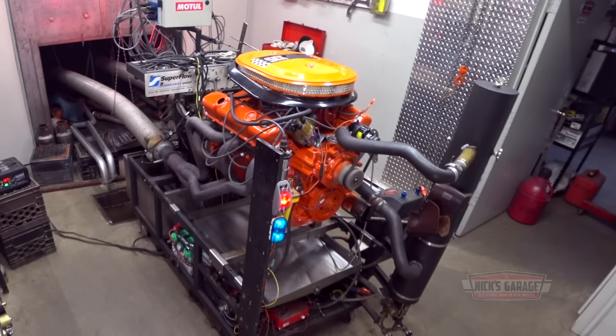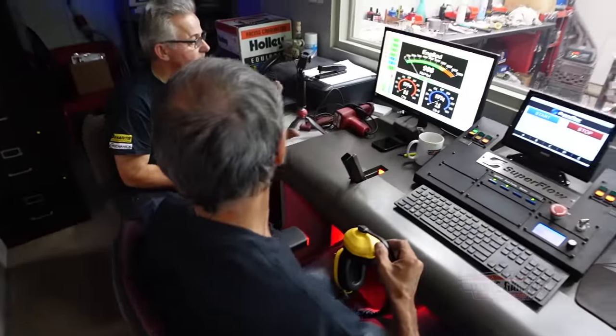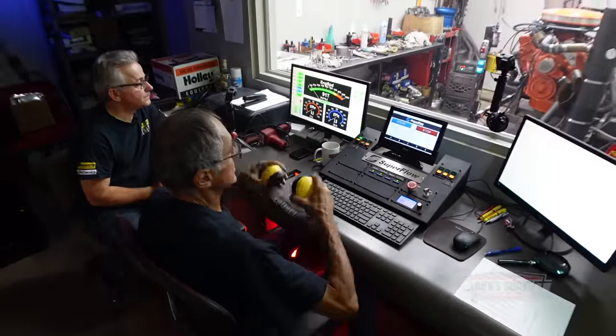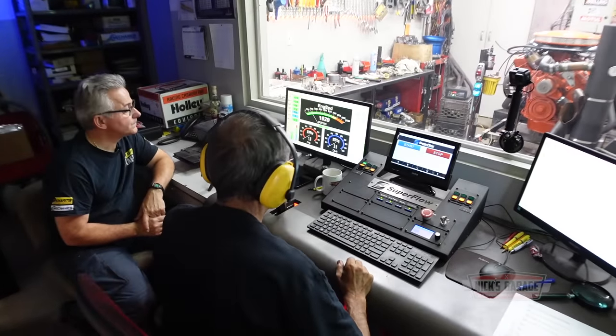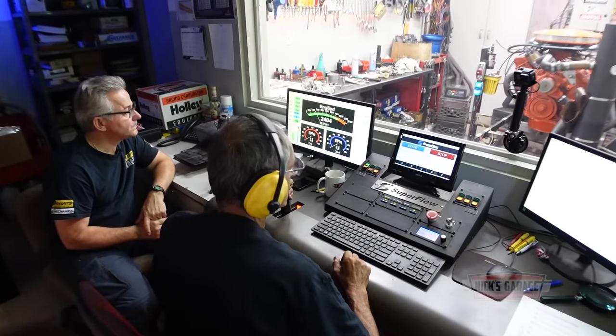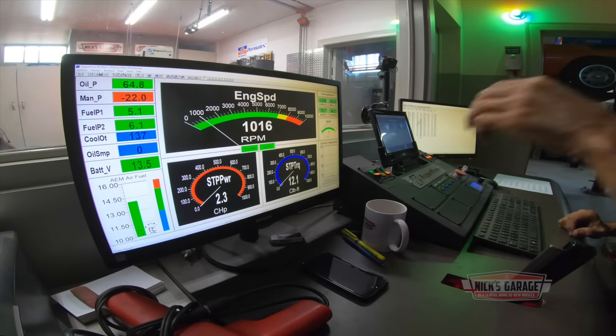So we'll make another two tests. We just advanced the timing up to 36, 37 degrees. We're going to leave it there and see how it goes. And here we go. The idle now goes back to idle all the time. That's good. Here we go. There's green over here. I get the temperature up, eh?